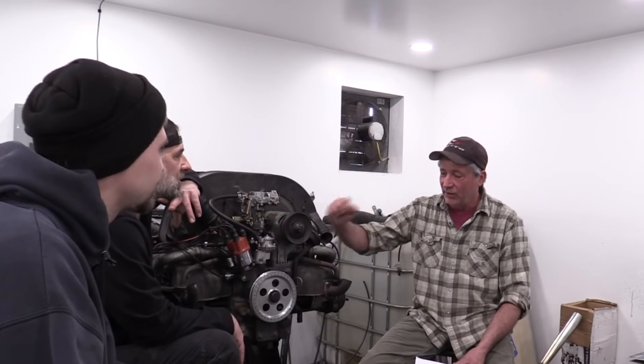What does back pressure actually do? It's pushing against your rings. As your rings are coming up to make detonation, back pressure is a counteracting force that's pushing your rings apart, getting better ring seal. That's where you see engines where people cut the muffler off — the compression leaks down and drops like crazy. But with this engine being so tired, the rings are already leaking, so it doesn't matter.